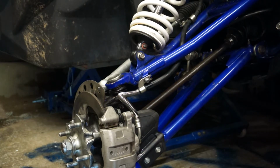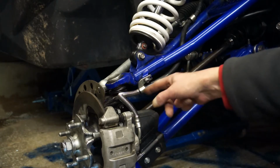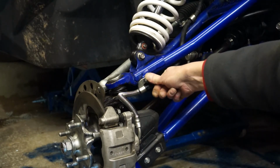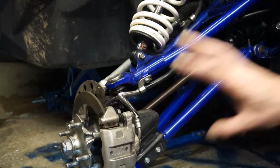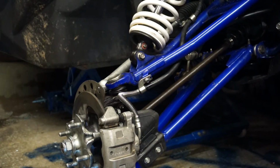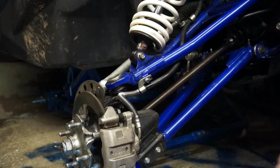I've just reassembled all the front suspension, drive shafts back in, attached everything, bottom ball joint, top ball joints reattached, track rod ends reattached, all torqued up, split pins, brake pipe clamps back on there, CV protectors on there, calipers on and tight. All I've got left to do, tighten the 32, stake it and put the wheel back on and drop it back on the floor, and that's job finished. So I'm just going to regroup and tidy up, and that's where we're going next.